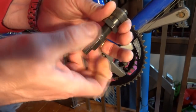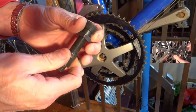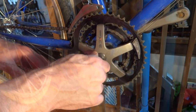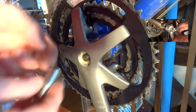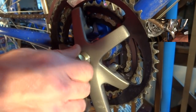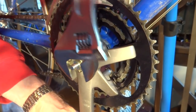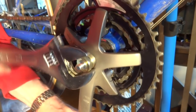Now I've got a crank puller here. I've got a couple of videos on removing cranks, so go ahead and click the link on screen. There's a bunch of dirt and dust in there. The threads where the crank puller will engage are kind of messed up, so I'm going to use a tool to chase them. I'll screw that on and thread this in — this will help clean out the threads so I can screw in the crank puller without stripping everything out.